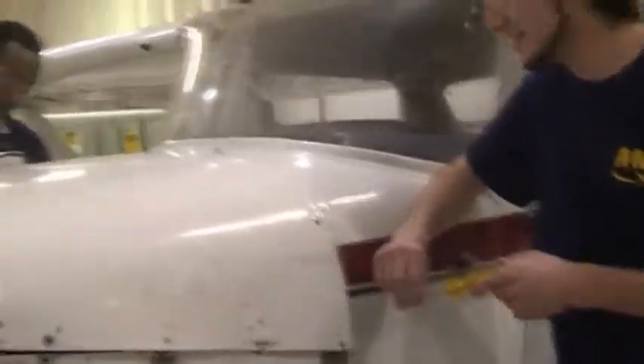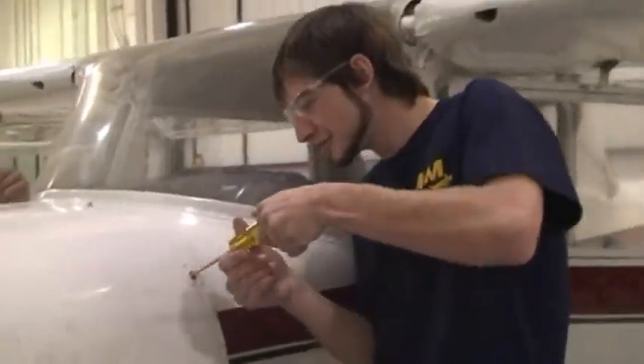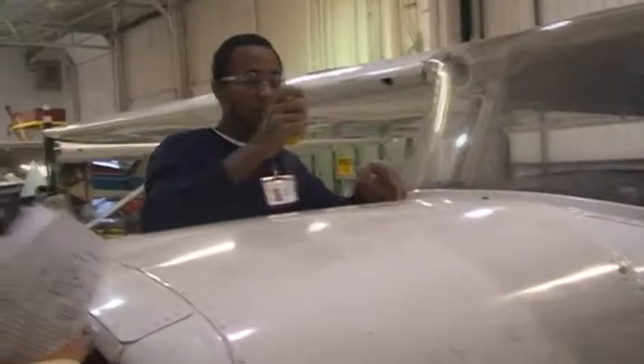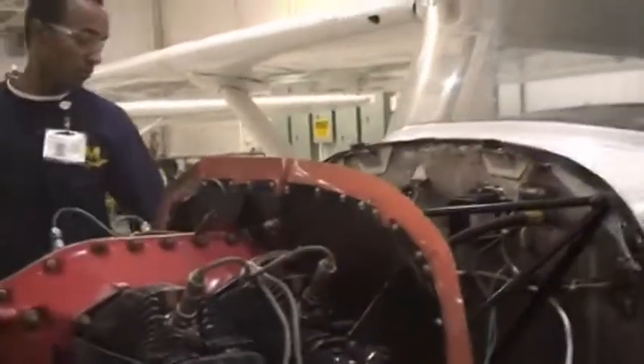Josh and Musi are opening the cowling. Release the quick-release fasteners and slide the cowling a little bit forward and up. Now we have access to the firewall where we'll take our datum measurement.